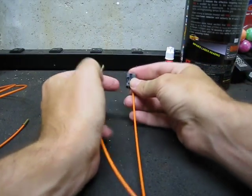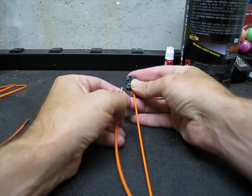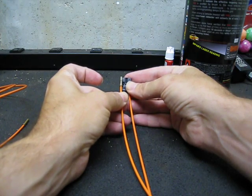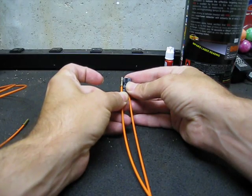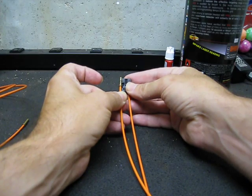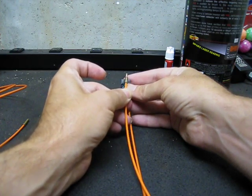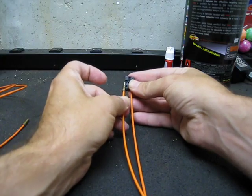You'll notice I've chosen to slide out the one with the arrow pointing down the fiber — that's the output side of the device. You would use this on nearly all installations. The only time you would not use this is if you have a direct connection to the radio with no other devices on the network, such as tele-aid or CD changer. If you had a bare-bones electronics car with no other devices, you would use the other side. But for most installations, you're going to use this side.